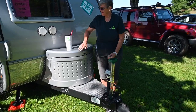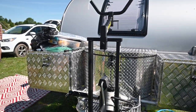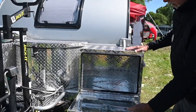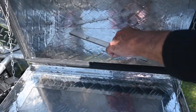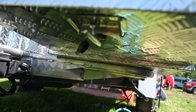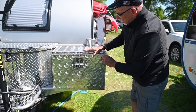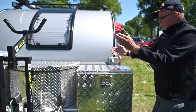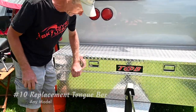These are two boxes I found on Amazon and mounted on the back of the tag. They store a lot of stuff. For mounting, I took a metal strip and put it all the way across with two bolts — I did not have to drill through the platform; the bolts go right through the holes in the platform with very large washers underneath. Make sure you put lock nuts on them so they don't come loose. The box closes and locks with a key and can be mounted multiple ways.